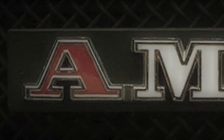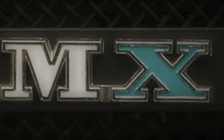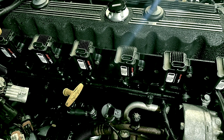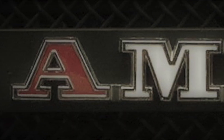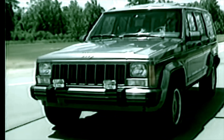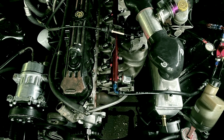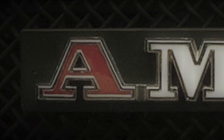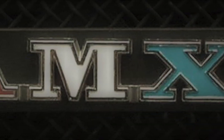So what is it specifically about those heads that makes them the best 4-liter heads? One of them is the boss for the valve guide. It had a big boss inside the port — big wide thing. What I do is go in there with a grinder and narrow it down, then round it back off. I gave them a flow box that had it narrowed down. They came to pick it up and said, 'Hey, you changed this.' I said, 'Yeah, you don't need all that metal in there.' If they can't hit the target drilling the guides — when you add up all the casting variation and the machining variation, everything could shift 90 thousandths. I made that thing so it could shift 90 thousandths and still have metal around the valve. So you took a big chunk of the valve guide boss out of the middle of the port — yeah, just took it out to try to get some more flow.